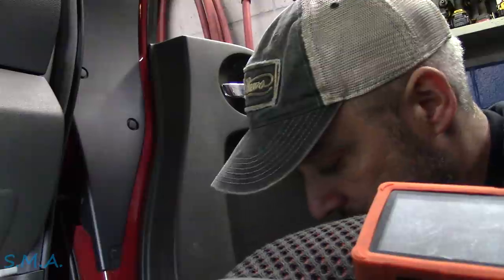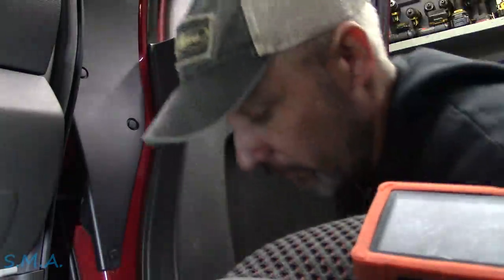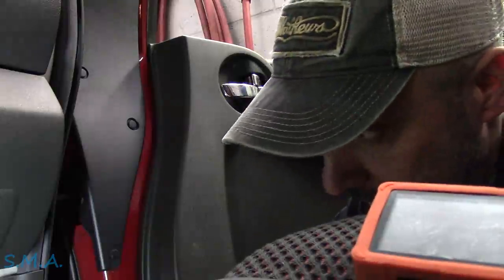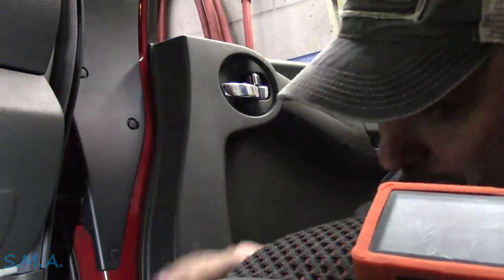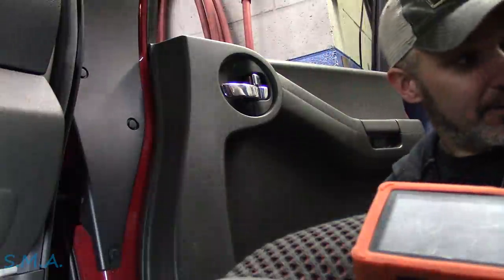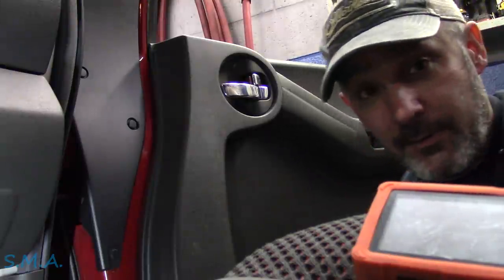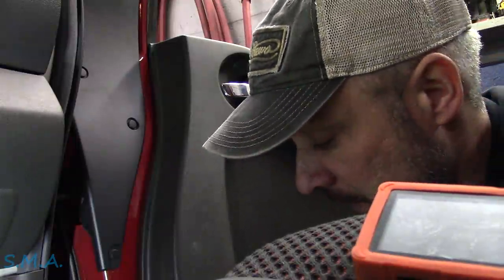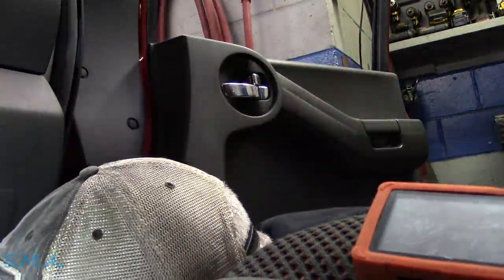The ultimate question is: why did the blower resistor fail? Lots of reasons. A — it's older and just kind of crapped out. Or B — the blower motor itself draws too much current, but that current spec isn't published so you're just guessing. You either get a new blower motor to compare, or you put a resistor in and if that goes bad in a week, you tell your customer: I'll warranty that out, but we should put a motor in it. That's typically how it goes if every mechanic's being honest. Or D — you could have poor airflow through the HVAC unit overheating the resistor and causing it to burn out.